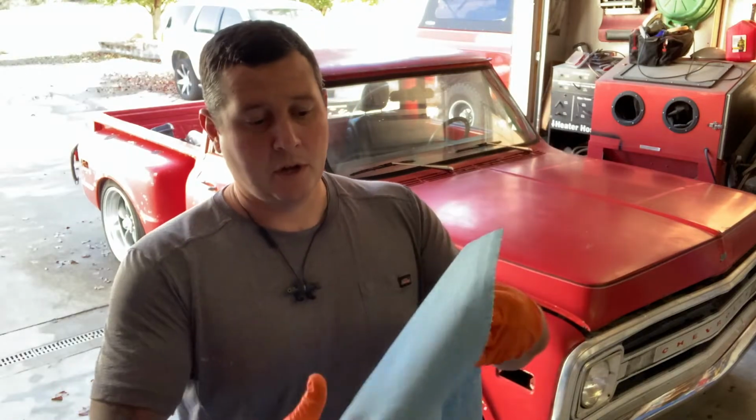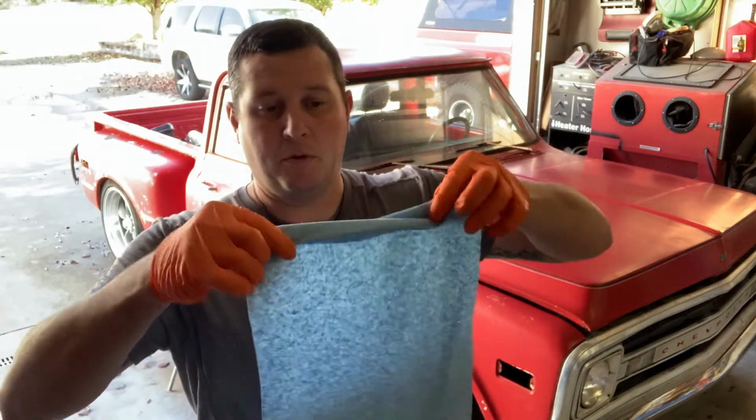So after about 20 minutes of the air nozzle blowing out any cracks in the paint, any body seams around the windows, etc., it's nice and dry now, so it's ready to start doing some of the degreaser I'm gonna wipe it down with. Now a little trick, what I do is start with your blue shop towels and then just roll them up into a nice roll.